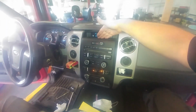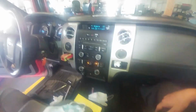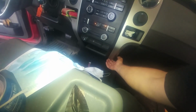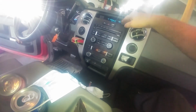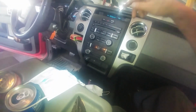Alright, quick summary. Remove this pad, lift it up with the pry bar, a little screwdriver, 2 screws here, a little screwdriver in here, pop this piece off, a screw here, pull these panels back just by hand on both sides. The edges should also pop up a little bit both sides, and then you can weasel this piece out right here. Unplug 2 items here that hang down.